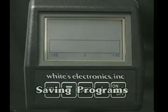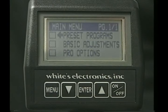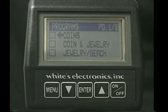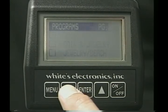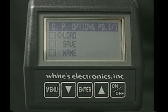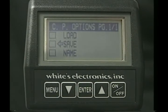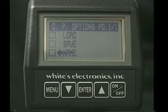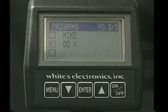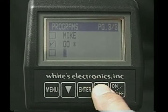Once you've made changes to either the basic or pro options, you can store those settings for future use. From search mode, press menu, then press enter at preset programs. Use the arrow down control to go to the custom program position you wish to store your special settings in and press enter. You are then given three choices: load loads previously stored settings; save will save your new settings with a generic or previously applied name; or the preferred method, which is name — select name and press enter. You then use the arrow controls to select the first symbol, number, or letter of the name you wish to assign that custom program.